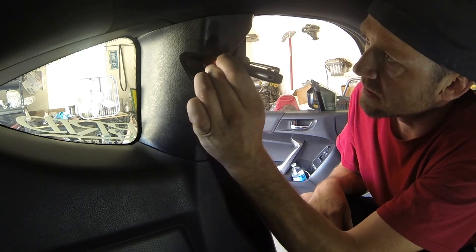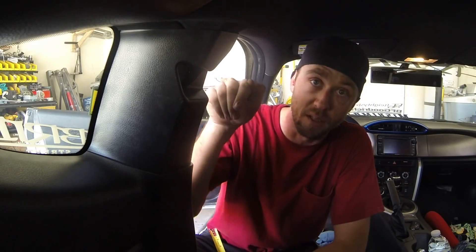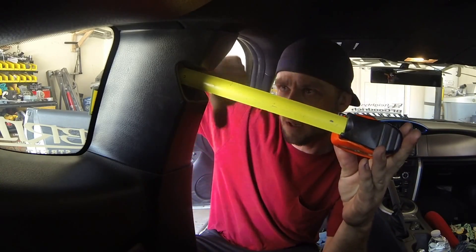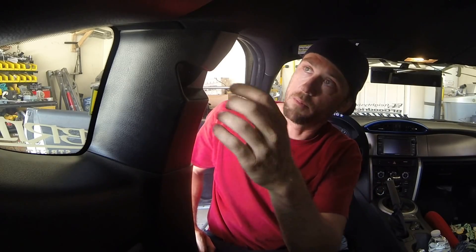To get right in between where we need to be, take a marker and trace out the bottom line and then the top. When we take the plastic off again we'll measure and find the center. We need to cut a spacer to bring the bracket off the sheet metal — without it, you can't swing the bracket because of all the stamping. We also need enough space to use the OEM hardware's swivel and still adjust the harness bar. Measuring from the sheet metal to the inside of the plastics gives us one inch, so the standoff will be about half an inch.